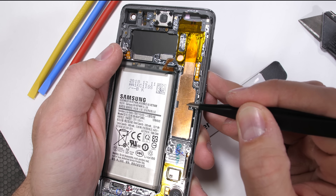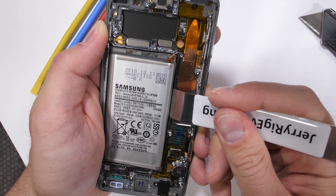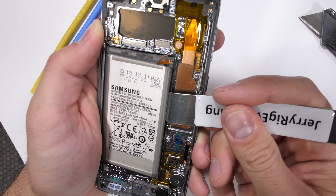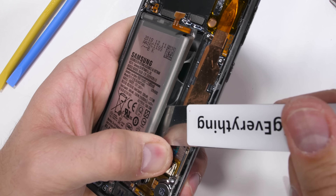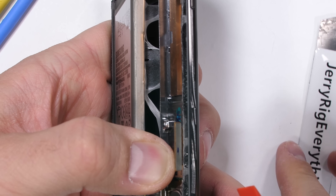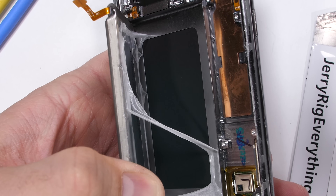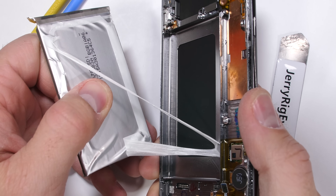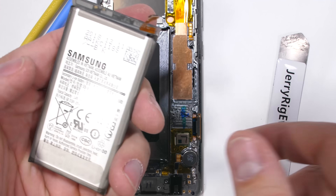The headphone jack is removable, and the vibrator is the same circular coin-style vibrator motor Samsung has always used. Samsung has made battery removal pretty difficult with a lot of adhesive holding it down. The annoying part is it's the same type of adhesive we see attached to magic pull tabs, but Samsung has conveniently left off the pull tab part to make it difficult. It's disturbing how far companies like Apple and now Samsung are willing to go to keep their phones non-repairable. It's bad news for everybody.